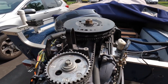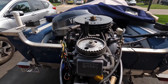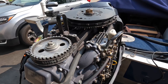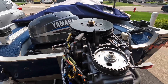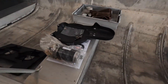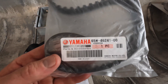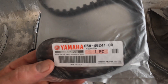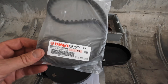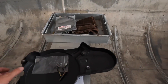While rope starting it, I noticed a lot of play in the timing belt — I almost thought it was missing a tensioner because there was so much play, that slap you can see when it's running. I had the shroud off so I could see it and I didn't love it. I'm going to replace that belt. I'll show you the parts I have — the Yamaha dealer starter and a partner belt that's good for 20, 30, 40, and 50-60 horse, the older 60s for sure.